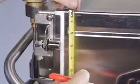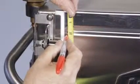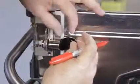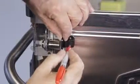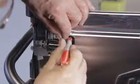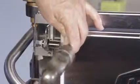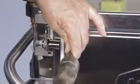Place target on door with flat side with holes to the door, placing it 1/4 inch from the door guide and 2 inches from the top edge of the door. Mark the locations of the holes on the door using the target as a template. Center punch the marks and drill holes with 11/64 drill bit.